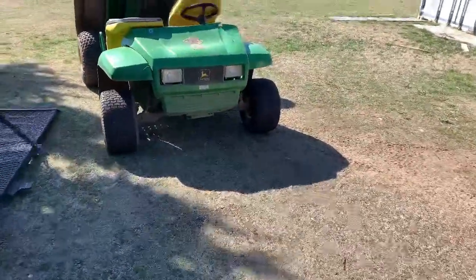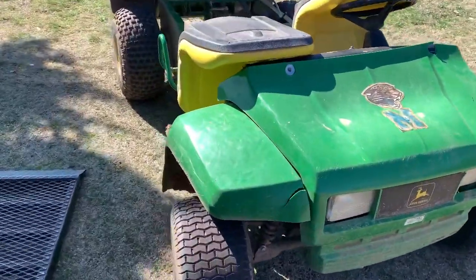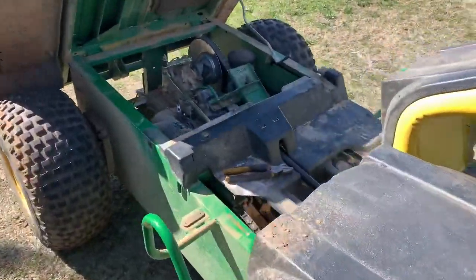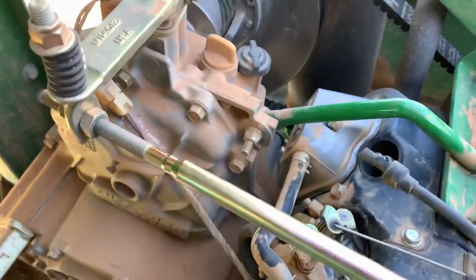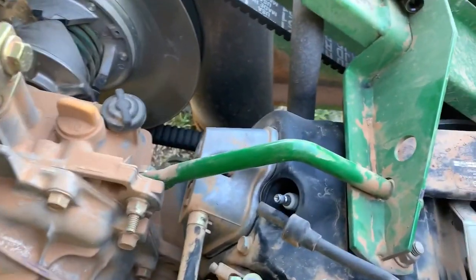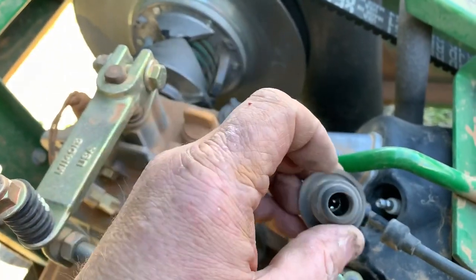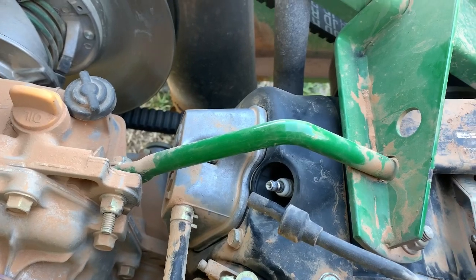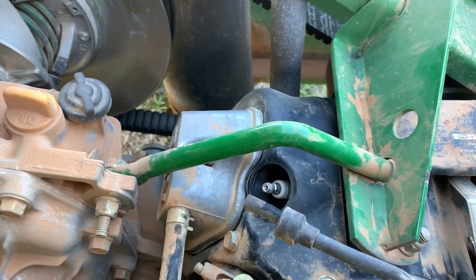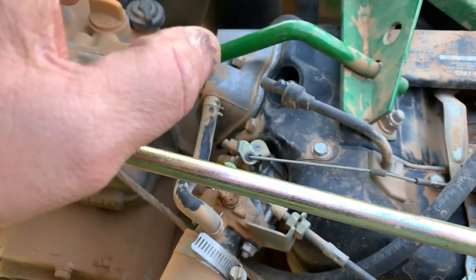The complaint is that it runs and dies — it bucks and snorts and pops through the intake and the exhaust, and it backfires at some points. It's not a fuel issue; I've ruled that out. I suspected it might be the resistor on the end of the spark plug wire, but that is not it. What's happening is this thing is losing spark at half throttle, and that tells me the internal workings of the ignition coil that control timing has failed.